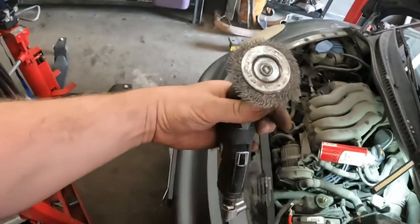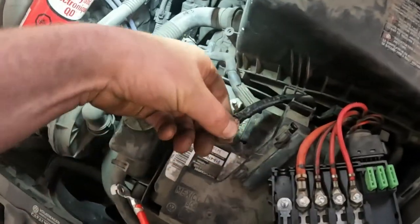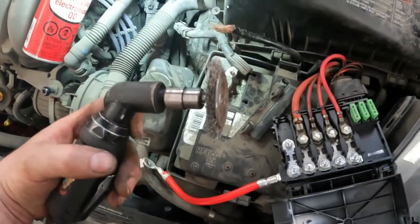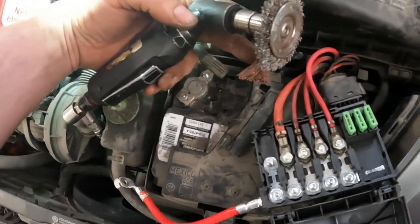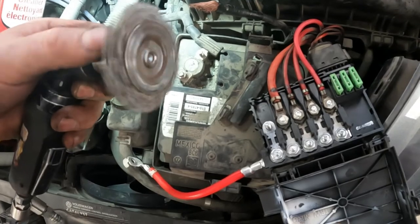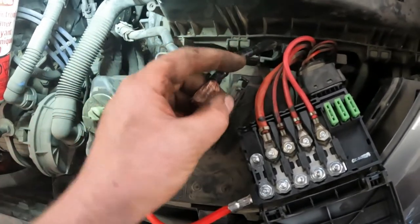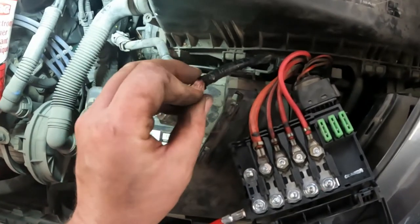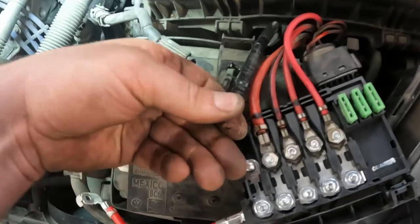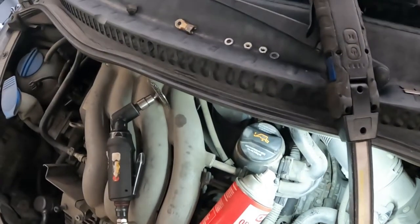So I'll use this. What I'll do once I get this off is spread the wires like a fan. Pay attention to which way the wheel is rotating — if your wires are fanned towards you, you want the wheel rotating away from you. You don't want it rotating toward you and grabbing the wires and bunching them up. You want to be brushing outward so you don't do any damage to the wires. Just gingerly touch it to clean them all up nice. Once you do one side, squish it up, go to another side, spread it out as another fan, and keep working around it. Spray it nicely with that and then put the clamp back on.